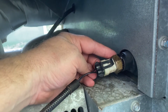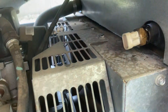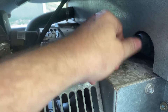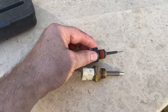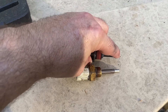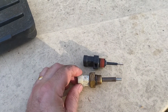Here is the original coolant level and temperature probe. We're going to disconnect the wire from it and remove it. You can see that the new probe is quite a bit different than the old one. Most notably, its body is plastic instead of brass. The continuity is checked between this piece here and the probe, as opposed to the body and the probe — that must have been part of the problem. So we'll put this one in now.